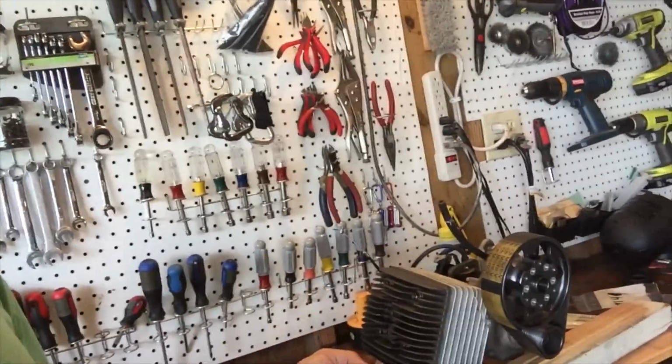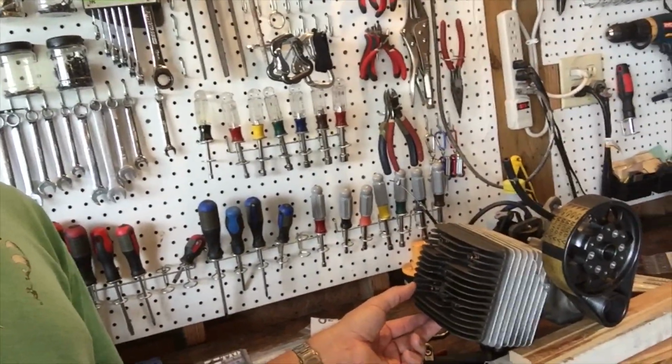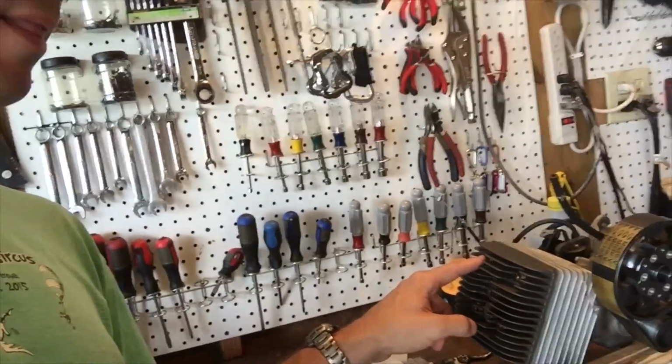You do not want to put it on the exhaust side, because if you put it on one of these 2 bolts here, you're not getting an accurate reading. So I recommend you put it on this bolt right here, the bolt closest to the pilot, on the carburation side. And it's going to give you a pretty accurate reading. It may be off. When I use the infrared gun, it's off by maybe 10 to 12 degrees. So just add 10 or 12 degrees to whatever your temperature is, and you're getting a true head temperature.